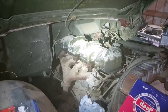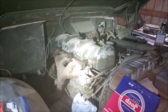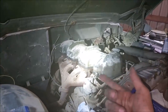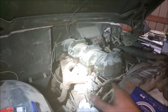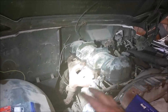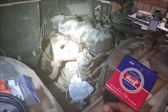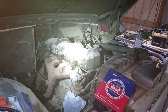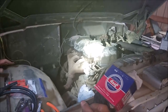Closing down here tonight — I think next time we're going to be able to start the vehicle. We only have a few more things left to do: rebuild the fuel pump, and we'll want to spin the engine over to get all the transmission fluid we poured down the cylinders, to hopefully loosen anything up that might have been stuck. We don't want to put the spark plugs in until after we do that, because we wouldn't want to hydro lock anything, and it gives time for the oil pump to prime up the rest of the system. I think we'll bump the starter and see if it's in good shape, and that'll end our video.